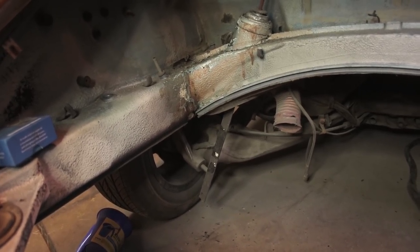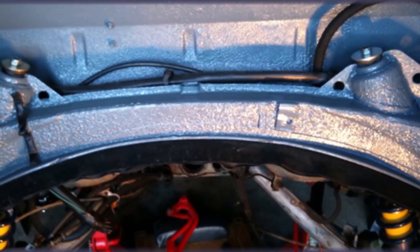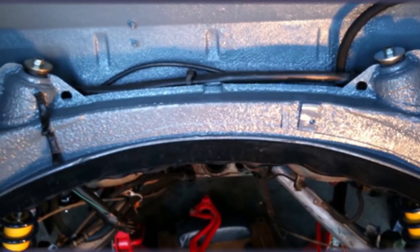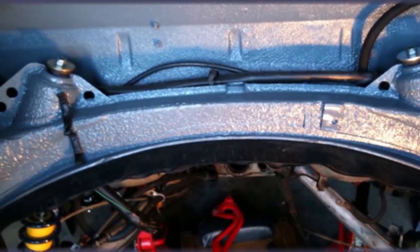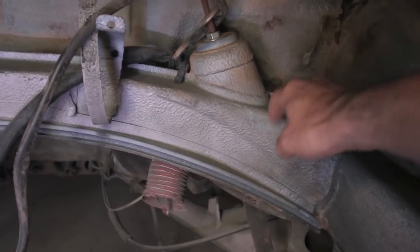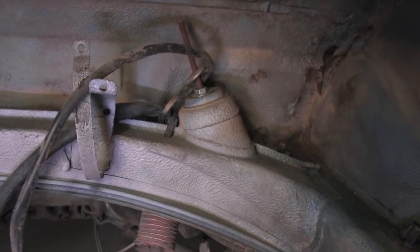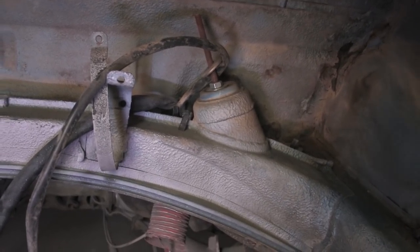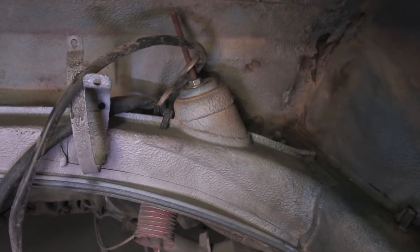The disadvantage of coilovers is that the structure of a stock Porsche really isn't designed to handle the loads in a totally different place. So as I mentioned, the stock design has all the loads happening under the back seats, and in a coilover design, all of the suspension loads and spring loads are acting on these shock towers. So they need to be reinforced, and that's what I'm going to be doing today. With coilovers, this area needs to be strengthened because it's really designed for shocks, which do carry some load into the top, mostly under either cornering or going over bumps, but the loads are much, much higher with coilovers because all the weight is supported on this. So what has to happen is this needs to be kind of re-engineered and strengthened.